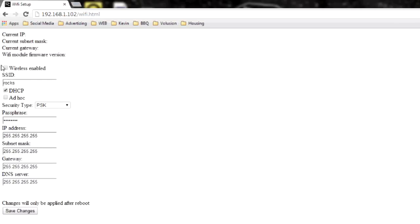When you get back to the Wi-Fi settings page, make sure that you enable the wireless again. Generally the issue is either the SSID, the security type, or the password or passphrase is incorrect. If you're 100% sure that those are all correct, you need to check your router settings to make sure that there's not something in there that's stopping you from connecting.